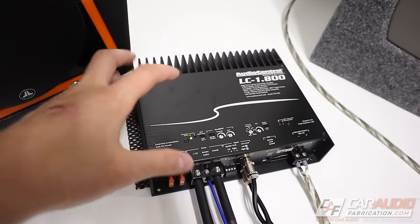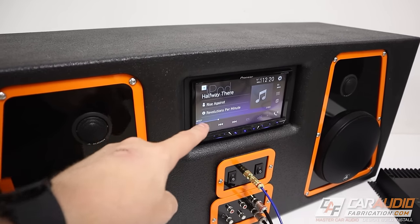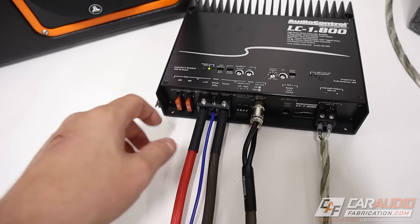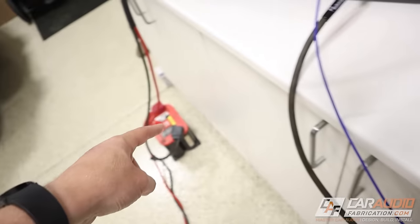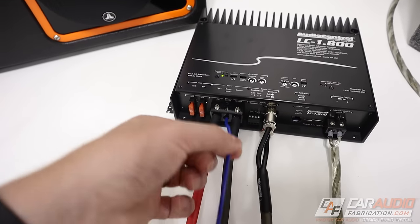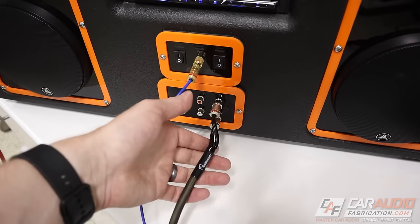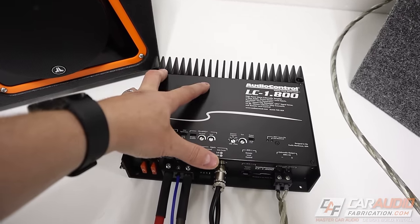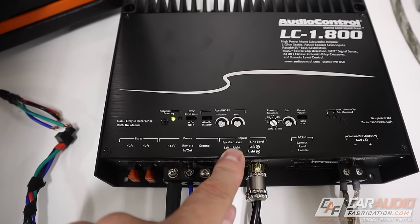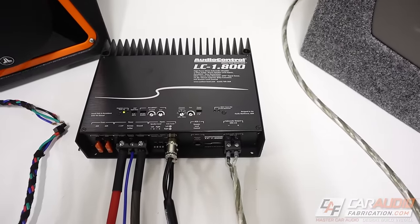In my testing setup here I have a car audio system basically removed outside of the vehicle. This is a car audio aftermarket head unit and car audio speakers powered by that head unit, and all of this along with the amplifier are powered by this car battery. As far as connections go, I should have a positive lead that runs to the car battery, a ground lead connected to the vehicle ground, a remote turn-on lead that tells the amplifier when to turn on from the head unit, a musical signal coming out of the head unit going into the amplifier — or if using an OEM system, tapped into the speaker wires using high-level speaker-level inputs — and coming out of the amplifier, speaker leads that connect to either the subwoofer or speakers.